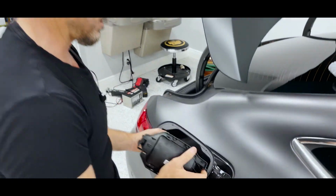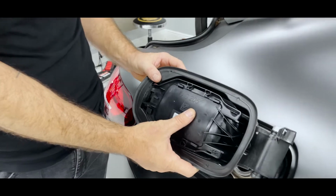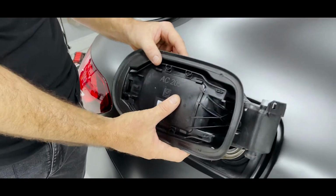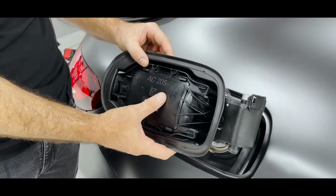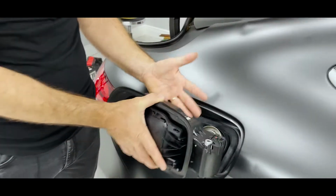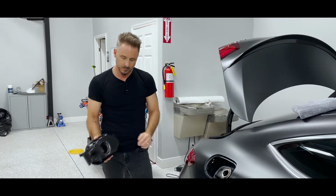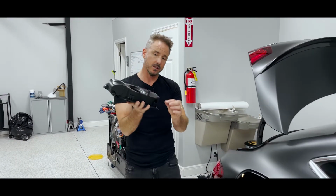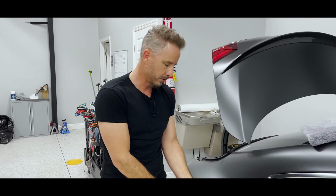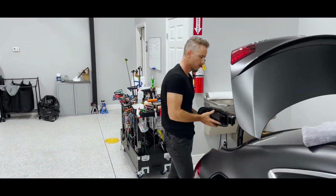This is in. Once that's done, you're just going to take it and you're going to gently wiggle it. I mean, gently. You can be aggressive, but don't be too aggressive. And then you're going to feel 1 or 2 pop depending on which orientation you're wiggling. And then you're going to be able to work this thing out. As you start to work it out, don't forget you got this, which is your overflow drain tube. You're going to want to pull that before you try to get it out.